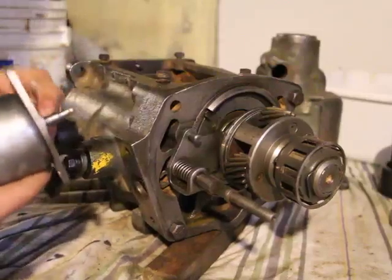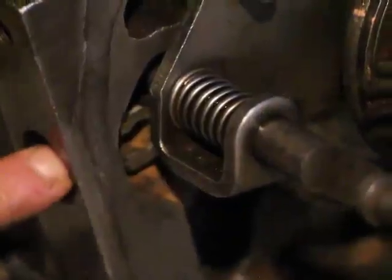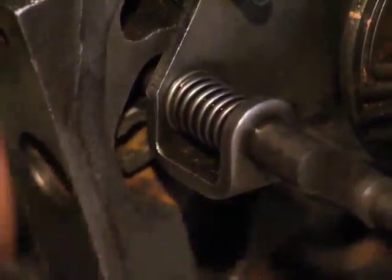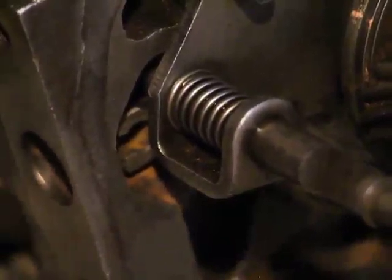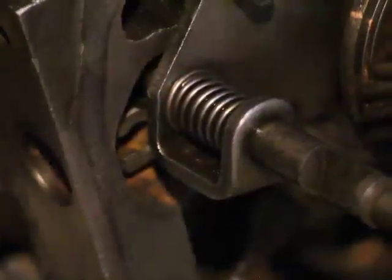For now, the main point is this moves in and out, and it goes onto that little square thing. Let's see what it's called. You see right there, it goes in through this hole and pushes that in and out. Okay, in and out. That's all it does. So for the purposes of understanding how this works, that's all we need for now. How that works separately, that's another video. But basically what this does is at a predetermined speed, those squares will open, close the contact points, and energize this, okay, thereby pulling solenoid in. So the normal position for this is closed as it is now.